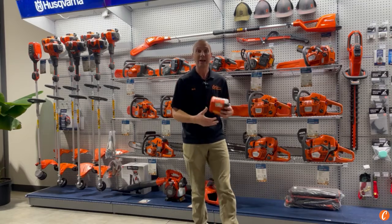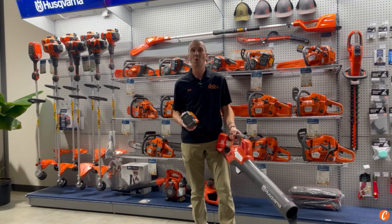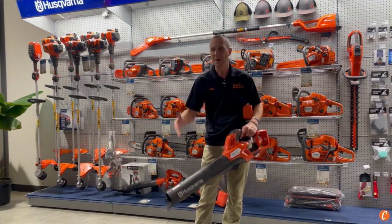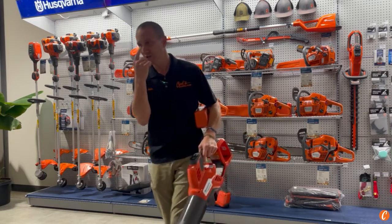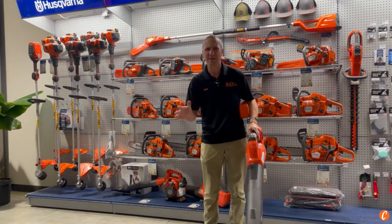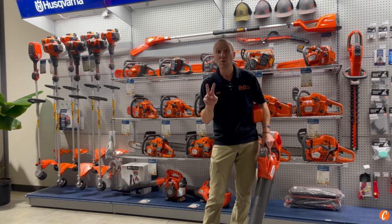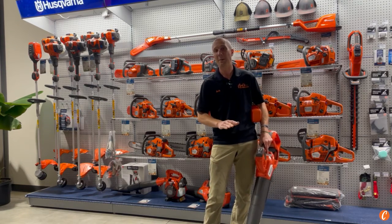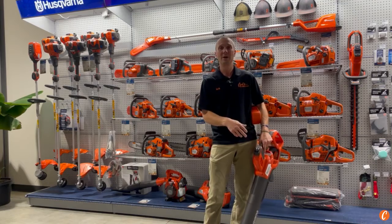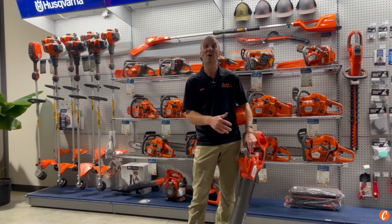Its capacity is big and you need it, because this blower is putting out some serious wind, which does suck down the battery. In the pipe, this is 800-plus CFM, 200 miles per hour, and it's putting out 23 Newtons. That's a combination of both things to give us a good true number. 23 Newtons — that's two Newtons more than one of their medium-size $400 backpack blowers. So this little guy is putting out 10% more power than one of their backpack blowers. And if you looked at the Husqvarna handheld gas blower, the 150BT, it's putting out like 10 Newtons more.